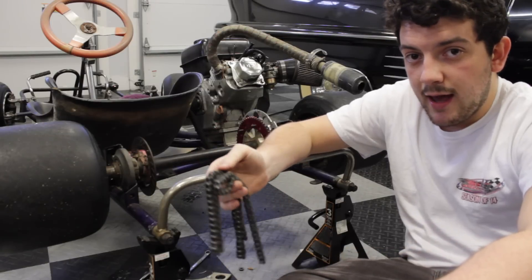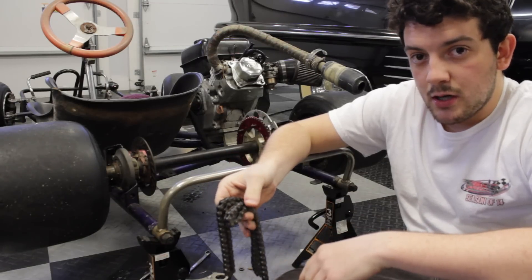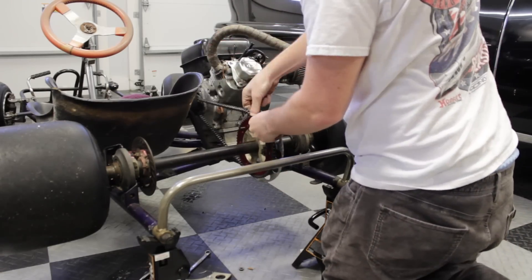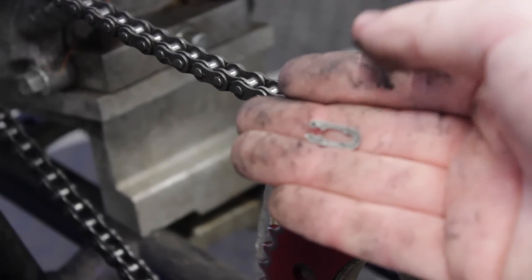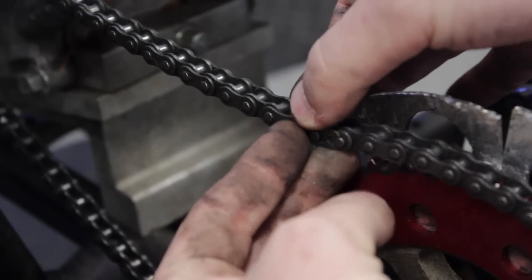Take your shorter chain and wrap it around the clutch and sprocket, then attach it using those clips — the same clips — and then adjust the engine to the point where it's tight. This little clip can be a real pain to put on. I put it on with the closed end pointing forwards — I'm not responsible for any harm you may cause yourself or others while trying this; this is just how I do it and it's worked for me. Put the first half on like that and grab your screwdriver and push on it.